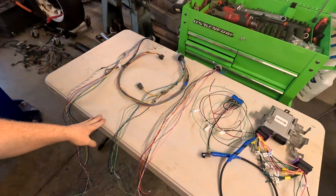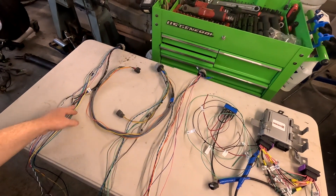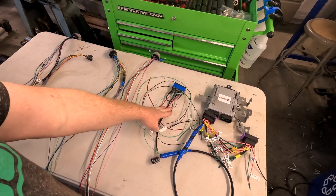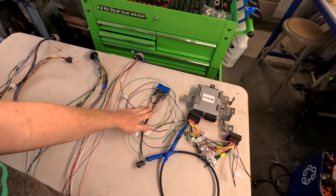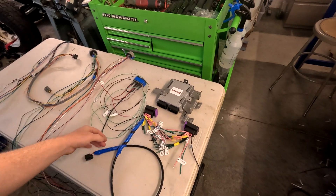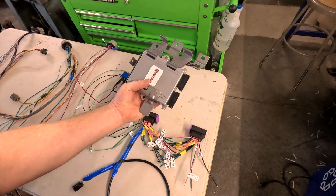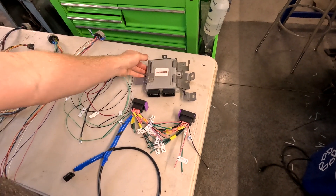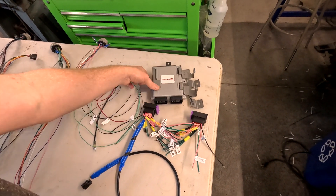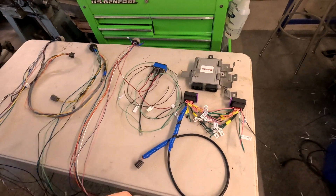I've been fleshing out the wiring now. Pretty much got the three main harnesses ready to go actually into the car. I've got a couple relays here for the inverter and for the cooling fan. I've got the throttle wire wired up to the Resolve EV's pigtail, and I used the ECU brackets from the original ECU to mount the Resolve — just had to notch some sections, but that's going to bolt into the chassis and hold the Resolve EV nice and tight.